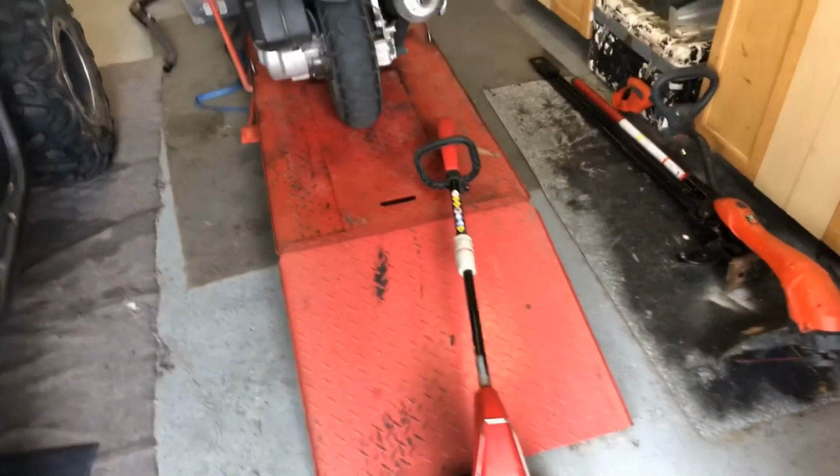If you got one of these things, like I said, that's $40 for one, but why throw it in the trash? A couple bucks, you can fix it, and now I got 4 of those thermal fuses. I could fix 4 more of these things. Save this unit from going to the trash, and learned something along the way. I mean, heck, if you don't have a soldering iron or some tools, you could buy $40 worth of tools and fix it. Then you'd have your string trimmer and you'd have $40 worth of tools. So now, that one's going into the donate pile here. And hopefully I'll get another one soon. I wouldn't mind getting a couple more because that was a pretty easy fix.